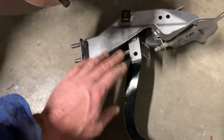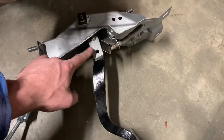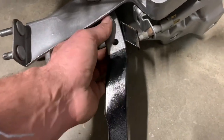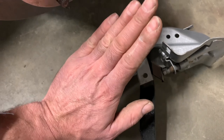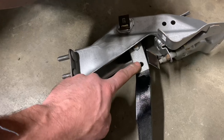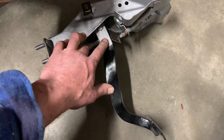This is the original brake pedal mounting bracket and the actual brake pedal itself. This is the same between power and manual drum or disc — they use the same setup. The only thing they change is the pitch of the master cylinder and the mounting hole that gets used. Manual brake cars tie into the top hole here, and a power assist car shoots the master cylinder at an angle — the brake booster and master cylinder are pitched up a few degrees toward the hood.